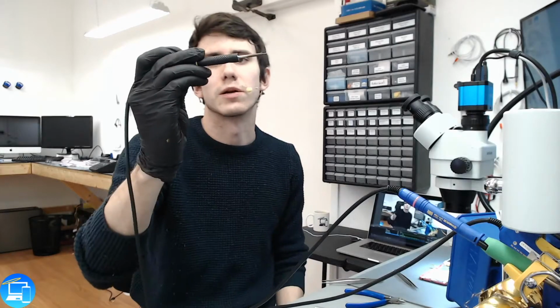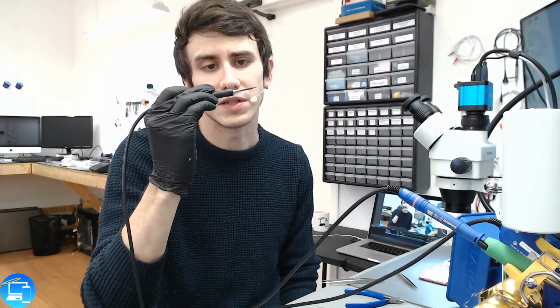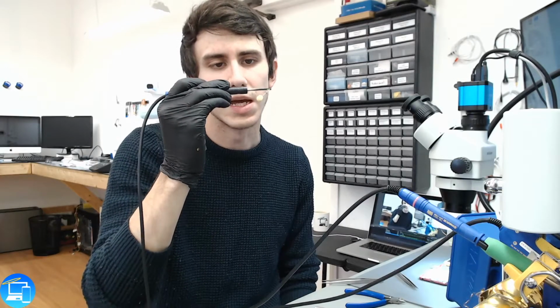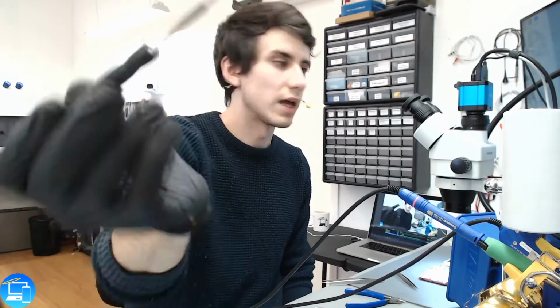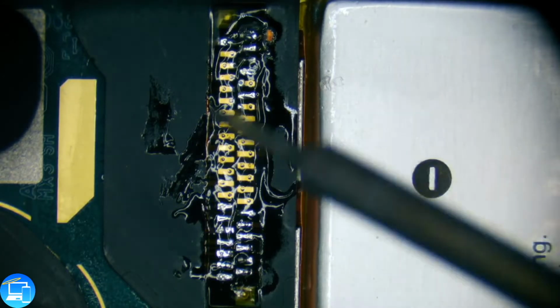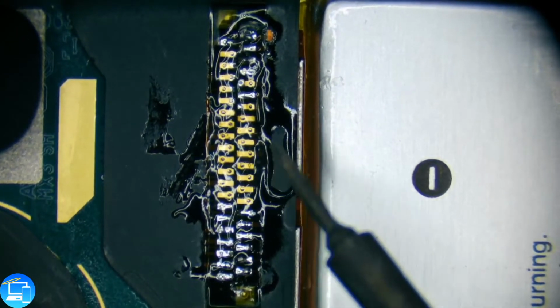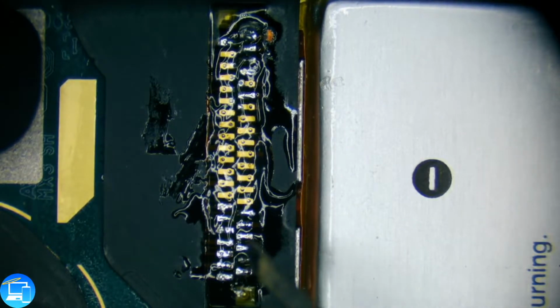At this point, I'm going to use my micro pencil with my chisel tip here. This is our FM 2032, and the chisel tip we have, or knife tip, I'm sorry. The knife tip is going to be a T-30 KN, KN for knife, and you'll see underneath the microscope a lot better that this looks just like a knife. See? And what we're going to do is touch each individual connection now.